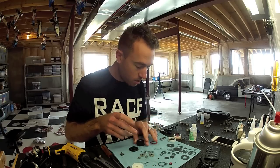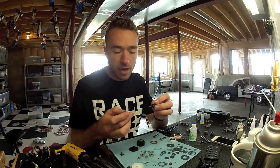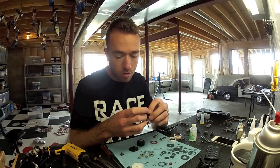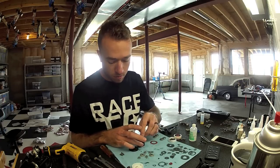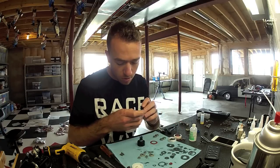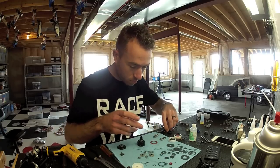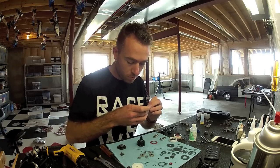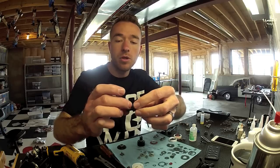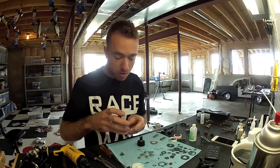Put the bearing over that, and then your out drives — get some more black grease, put it around the shaft like that, and put that in. Now we'll do the gear — do the same thing. Where you have that groove in the out drive is mainly where you want to get your grease. Put that in.